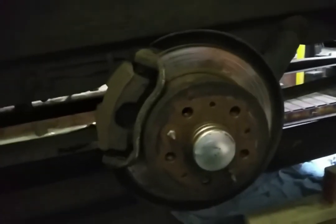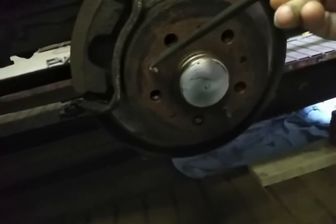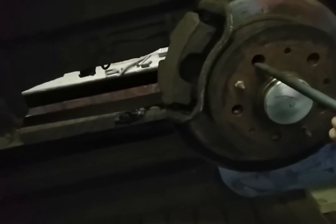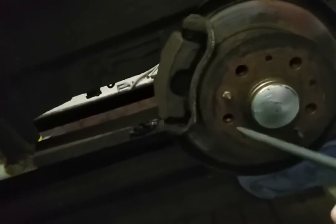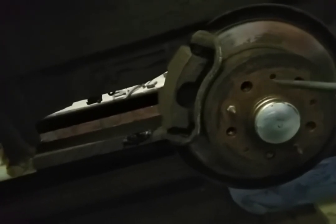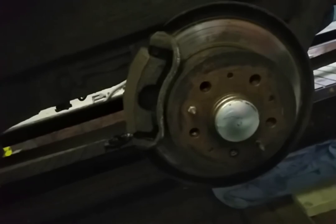To get that off you have to take the foot brake caliper off, and the caliper mounting bracket — it's two nuts behind here. Put that over the back, take the pads out. Don't let the caliper hang on the flexi pipe because you could damage it. Then you need to take these two little location pins for the wheel — take those out. And about here there is an adjusting wheel for the handbrake shoes. What you have to do is get the hole lined up — it's very awkward and you need a light — and flick it round to make it loose. You'll be very lucky to get this off if you don't back the adjustment off a bit. And then this comes off. I've got the other side all stripped — I'll show you on the other side.